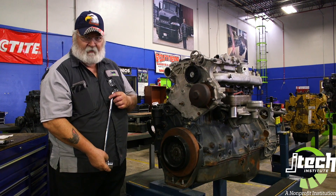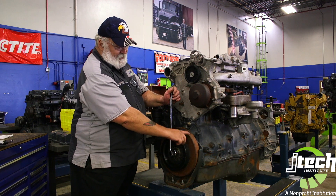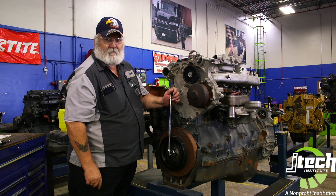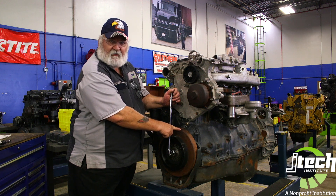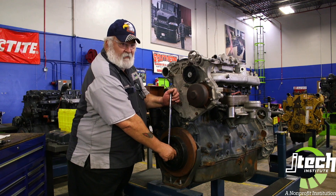The next thing that you would have to do — I have this one preset — but you would put your 36 millimeter on here and you would actually rotate this around to where you can see the timing marks on the engine. You notice we have a pointer here and we have a mark on our vibration damper, which gives us the correct engine position.